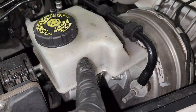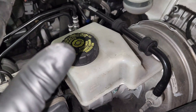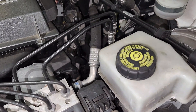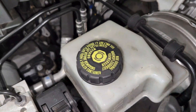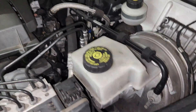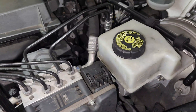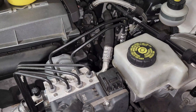In short: make sure the level of your brake fluid is topped up after doing your brake service, and never add any brake fluid unless you have a leak in the system — that summarizes it all. If you have any related warning lights on the dash concerning the brakes, it's always good to consult your mechanic and run a computer diagnostic to know exactly what you're working on. I hope that helps you take care of your car from home. Leave any questions in the comments, and we'll learn together. Drive safe, and please like and subscribe.